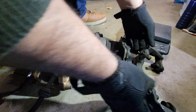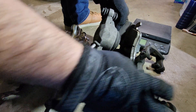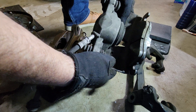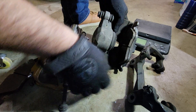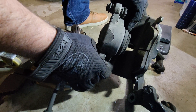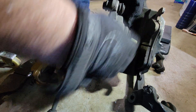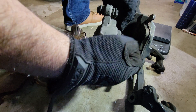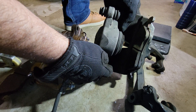What happens is as the brakes get hot, this metal expands. All of these pieces expand, the holes get looser, and the caliper can rock. When the caliper rocks, it can get caught on these metal tangs and actually seize — keeping it from moving.